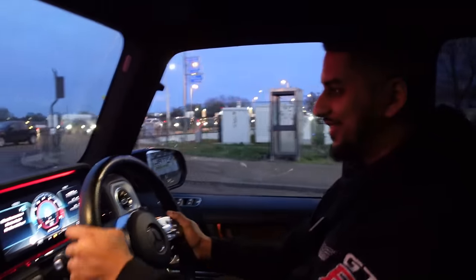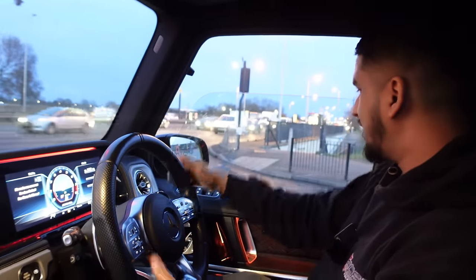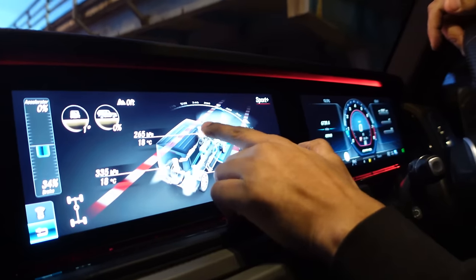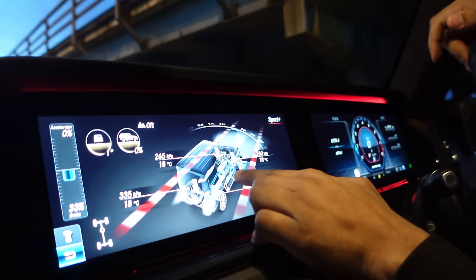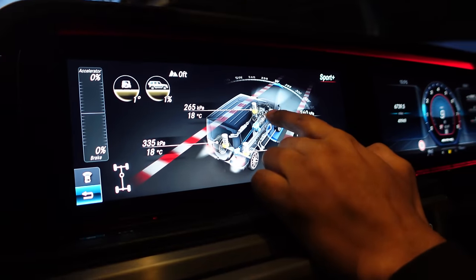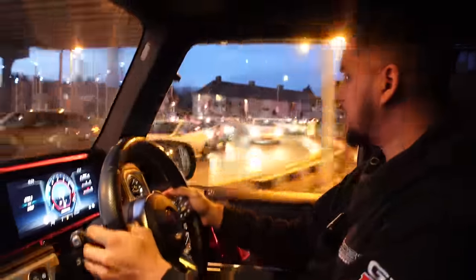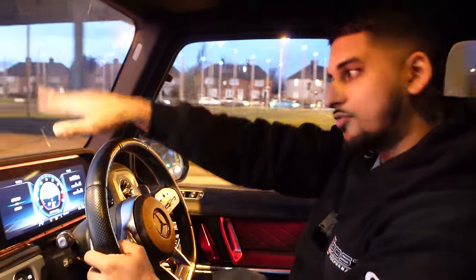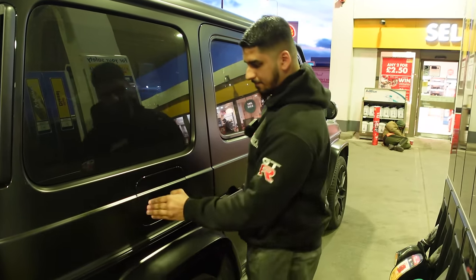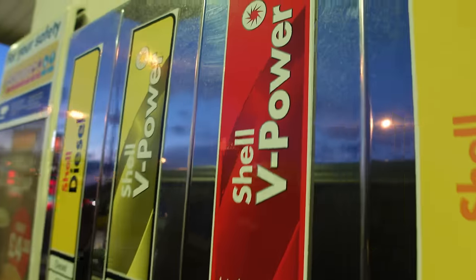I think I want to buy a G-Wagon now — I'm falling in love with it. In the beginning when I drove this car it was a little quiet, but now it's sounding so beefy. This car sounds a lot more aggressive than my E63 S. The downpipe we fit literally goes there and stops there, and you can see the OPF filter which we removed. The exhaust path is very short, a bit like a V10 in other supercars where the engine's at the back. A short exhaust makes them sound a lot louder compared to cars that go through resonators and back boxes all the way to the rear.